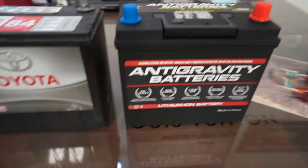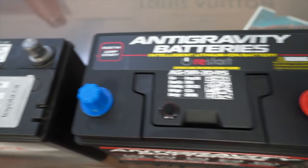That's the reason why I chose the anti-gravity lithium battery. Another pro — you can store your car with the battery and it'll have a really, really slow discharge. With the other battery I had in there, one or two weekends and that was it — just toast. And if your battery ever does go into sleep mode, the anti-gravity battery has that onboard restart button. For guys that have the batteries in the back of the trunk and did, like, a door shaving or delete and can't get into the trunk to access the battery, they have an answer for it. Other brands don't have it — anti-gravity does. You just press the button, it'll start the restart sequence and you can start your car. Pretty neat feature, you guys. My other battery? I didn't have that option.